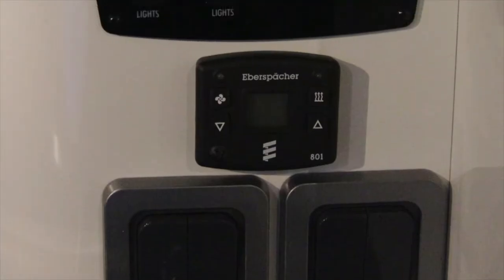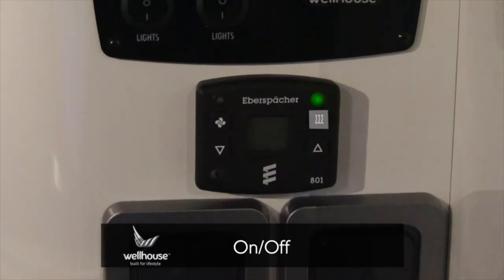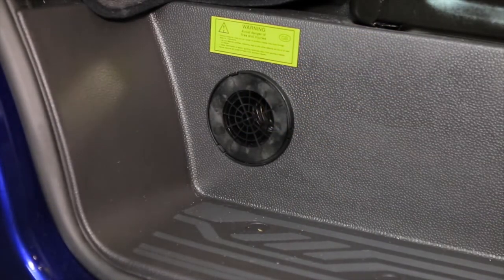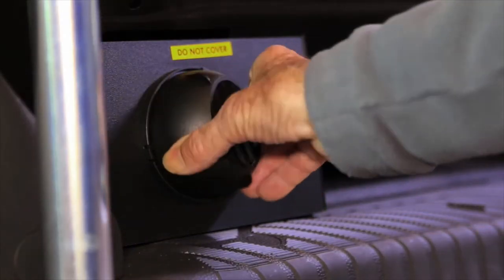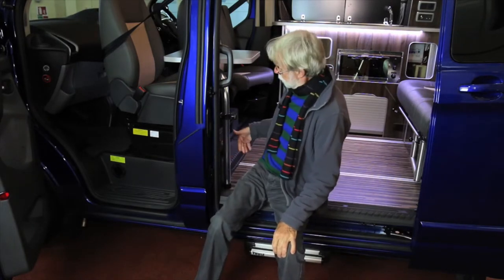The cabin heater is a great addition to any campervan — it makes the vehicle truly usable throughout the year no matter what the weather conditions. It's a very simple, self-contained unit with a single control on the panel. Turn it on, a little green light flashes to show it's active, and it sounds a bit like a 747 taking off as it warms up. But once it achieves operating temperature, the fan goes down and it's just a background hum. The air intake is in the passenger footwell — important not to block that with mats, books or a handbag. The outlet is under the passenger seat with a swivelling nozzle so you can direct the heat either up or down. Don't cover it or place things against it, as the air can get quite hot. There's lots more information in your pack.